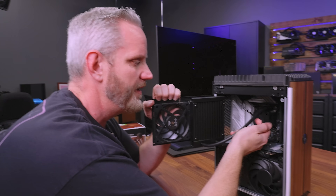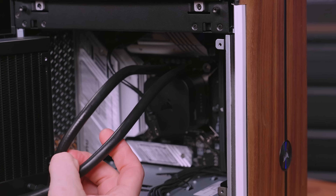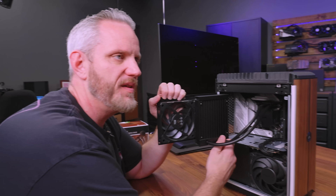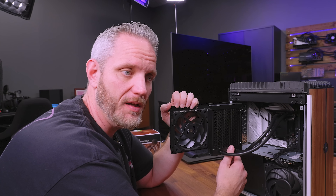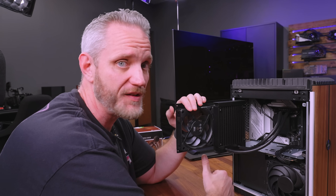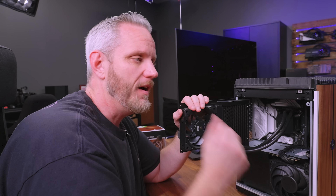When we did our previous test, Cinebench throttled hard — down to around 30,000 to 31,000 score, basically dropping to the performance of a 14700K. We dropped all-core clocks down to around 4 GHz, losing more than 1.3 GHz of all-core clock speed. Even our E-cores hit 100°C.